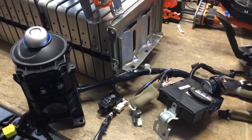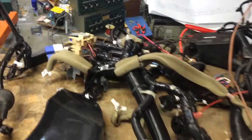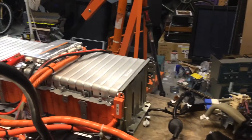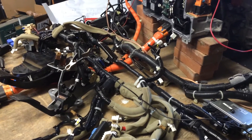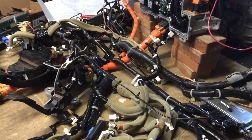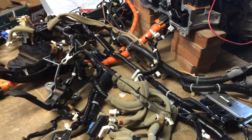The real trick to getting this whole thing working is that you need to have the BCM, the VCM, and the LBC — the battery controller — not only present but all from the same vehicle. They are all key-coded to one another, so if they don't read back the correct ID code, they will not work together. The only way to change that is if you have access to the Nissan Consult tool, which is unfortunately a very pricey item. Barring that, you would have to have those three items all from the same vehicle.